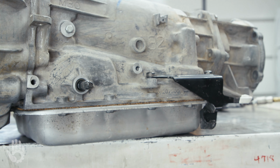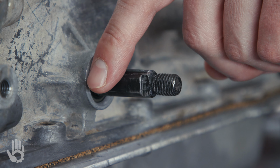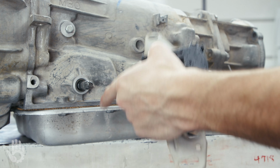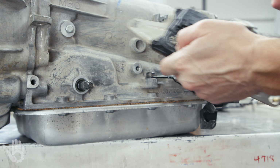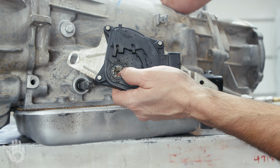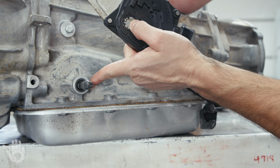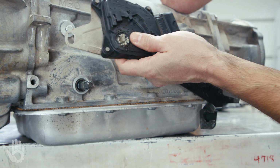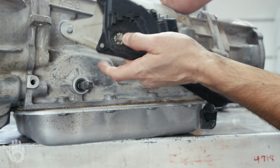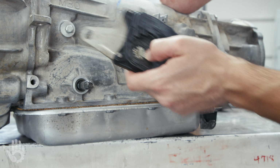Speaking of the fit, the shaft itself, there are flats on opposing sides of the shaft. So the shaft should be round, but it's like a circle with flats on opposing sides. The inside of the MLP is no exception to that. It's round, but it also has corresponding flats on opposing sides, and they, of course, correspond with those flats, and that's what enables the inside of the MLP to rotate anytime this shaft is rotated or the shifter is moved.